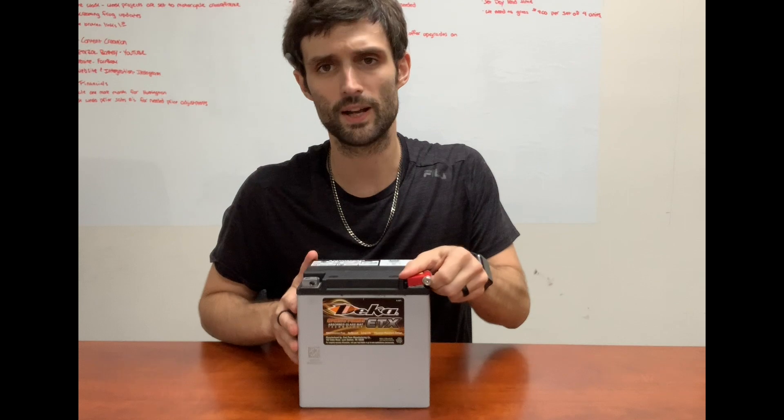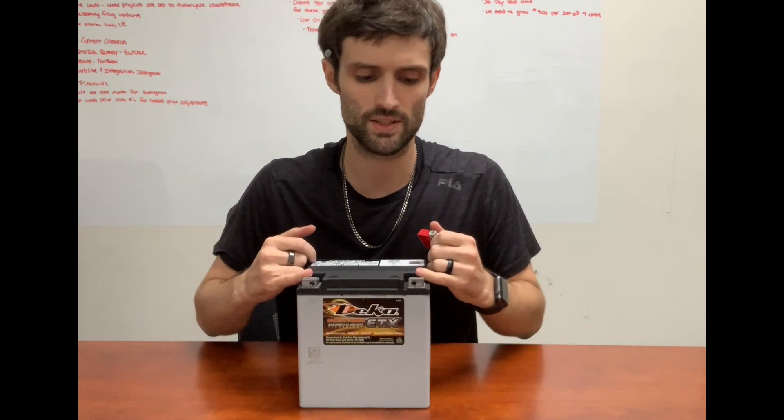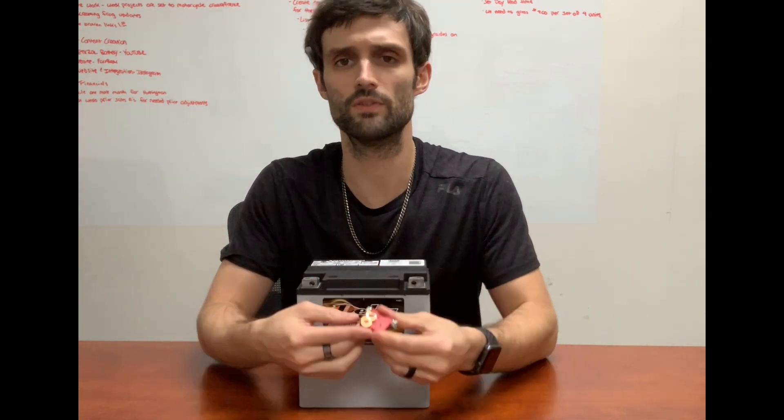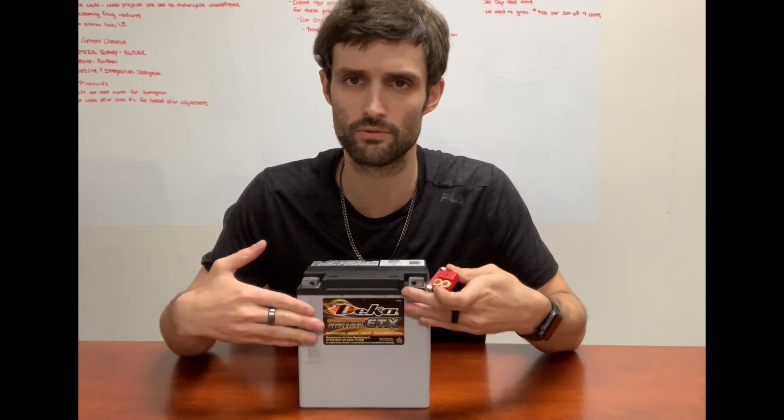The battery itself gives you two mounting options — you're going to be able to mount from the very front of the battery or from the top. It's a solid mold, pure lead. The hardware they give you here, if you're going to be mounting from the front, it's pretty important to use the brass spacers. They're milled down on one side so they can't spin, so they'll sit right on the very edge and give you a flush mount so you don't crimp your wires.